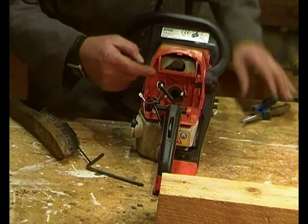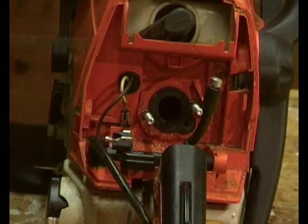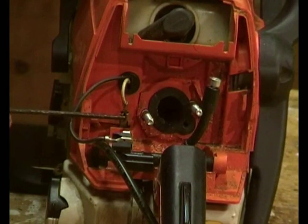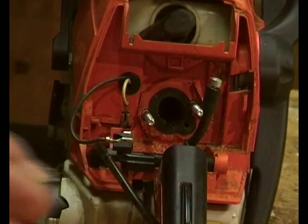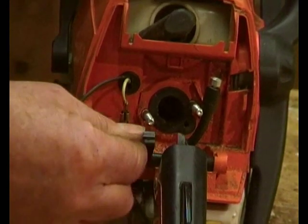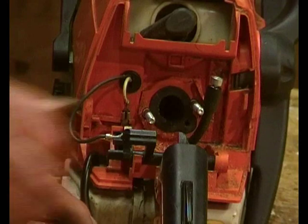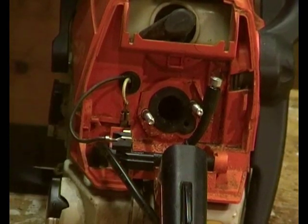On with the carburettor. Again, we've got to get everything in the right place. So before you get any further, make sure you get your control wires connected. One of them, the shorter one, goes to a spade connector on this end. The other one, the connector goes in there like this. I think this has been bent, so we're going to have to organise that. But effectively, as that goes up, it shorts against that. So what it does is shorts the coil out. And then as you go on to start, it drops down there, so there is no connection. So get those sorted first.